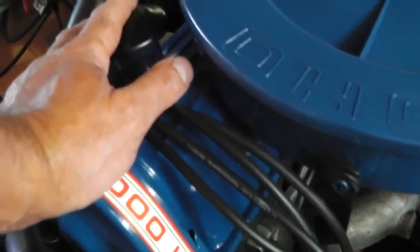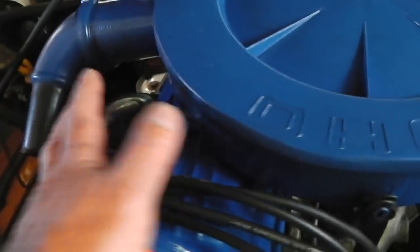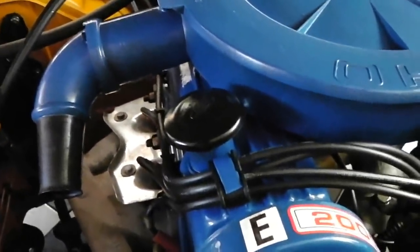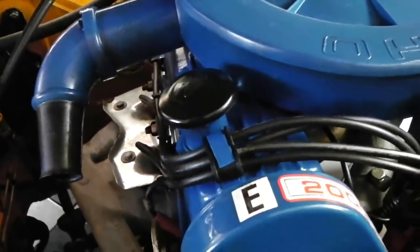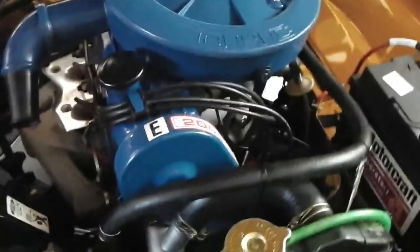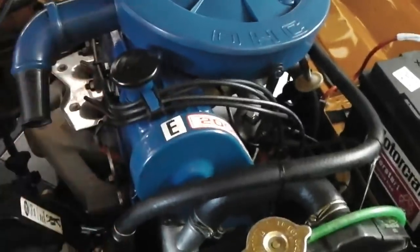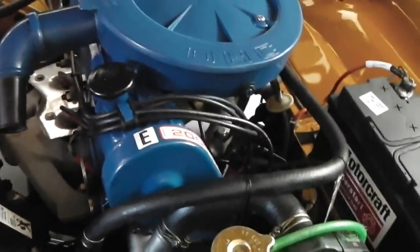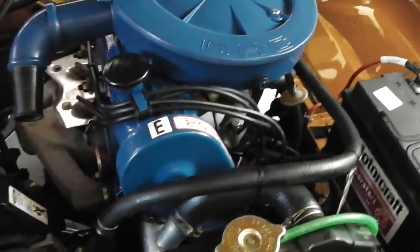There's various reasons. It could be to do with pre-detonation if the cylinder head's too hot and the fuel air mixture's coming in. I've got a Kent FR30 cam on here, which does idle quite nicely. They said put your cam on and you get rough idle. Well, with the FR30 cam, that doesn't seem to be the case. It'll tick over right down to 500 RPM and won't be lumpy.